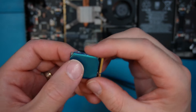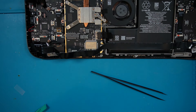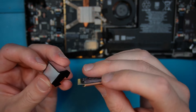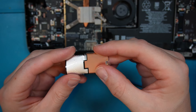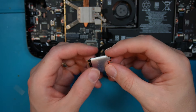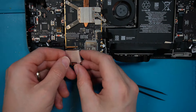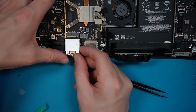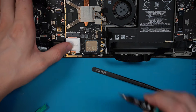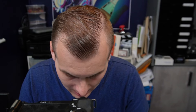Now we can put our new SSD in — it looks something like this. We can move it around a little if we need to. Then I'm going to take the plastic backing off the heatsink pad and get this back inside the RF shield. You might have to slightly poke the shield up and put some new tape on it just because the heatsink sits a bit bigger. RF shield goes on and then we put this back in place. You have to come in at an angle just to get it to sit in and then push down on it.